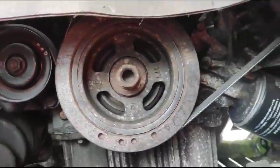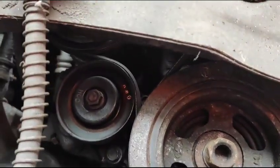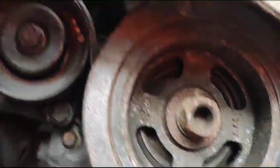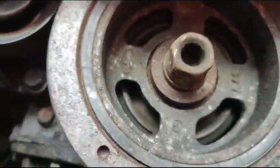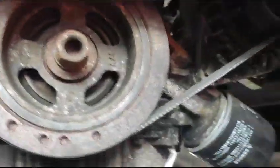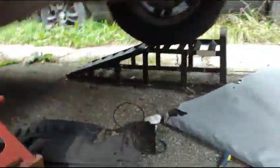If you've got an air conditioning belt, it's better you remove that one and change it too — it's so easy. There's a little bolt here again — anti-clockwise. Loosen the 14 millimeter pulley anti-clockwise, loosen it, and change the air conditioning belt. Here we go — that's the pump, right up there, and there's a little pulley that sits here. So that's that side, and this is the alternator belt side. Of course there's a little panel there covering this area — you remove that one too.